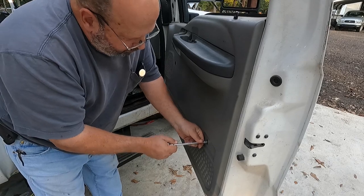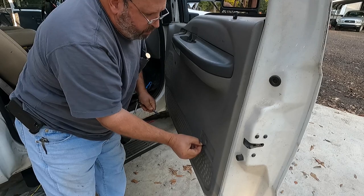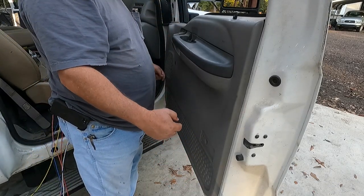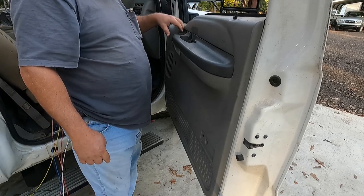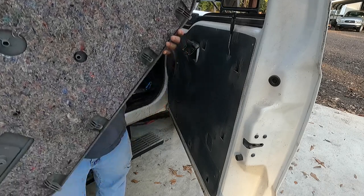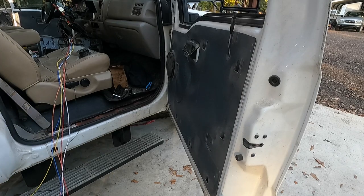You're going to have a bolt down here under the reflector and right here under this cover — those should be seven millimeter. The dash stuff is mostly eight millimeters and the speaker stuff is even smaller. On these door panels, a lot of them get crushed. The old-schoolers want to pull these off, but these have J-hooks behind them. Once you have the two bolts out and the piece off — if you had power windows, unplug those — just lift the door up. That's it.